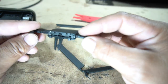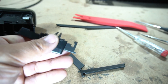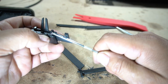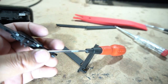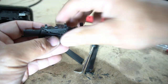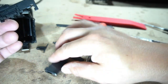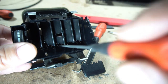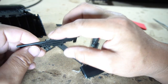Now for the important part — replacing the clip. You can see why it is really hard to just take this off from inside the vent. What you need to do is pry open the faceplate. There are four clip tabs and it also clips in on the sides. That's why I use pick tools — pick tools are amazing, they really do get you out of a lot of situations. That's one side out. Then we just get a flat head on this side and pry it out. And that's how you take apart the tab. That's what you would have to do to take it apart and replace it.